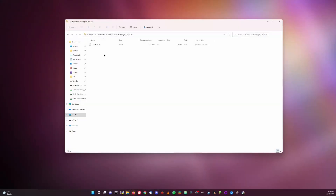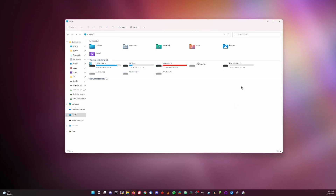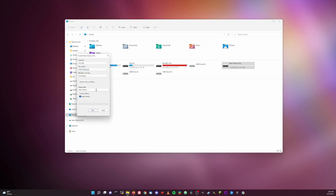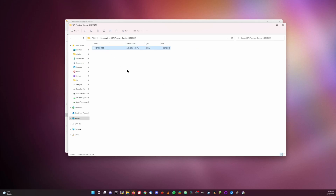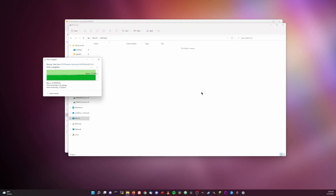Other manufacturers may require you to just place the zip file directly or do some other things with the files, but ASRock keeps it simple. So based on those instructions, since we already have the files downloaded, let's just unzip them and then plug in a flash drive. Let's open up File Explorer, right-click on our drive and click format. We need to format this to FAT32 as we read in the instructions. Let's just do a quick format. Now let's copy the unzipped files from our downloads folder onto the flash drive and reboot and head into the BIOS.